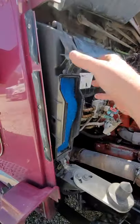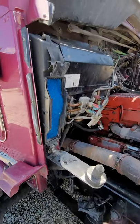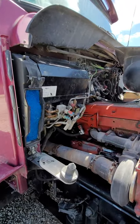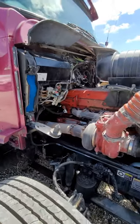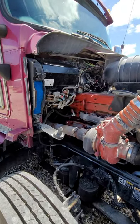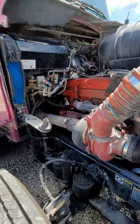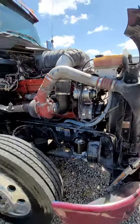He lost the cover that goes to the cabin filter. The actuator in this blower motor was broken, so it's actually now zip-tied to the recirculation setting — there's no direct air coming in there. That seemed to be kind of common on these. Fluids were good.